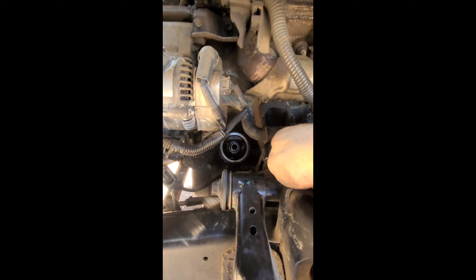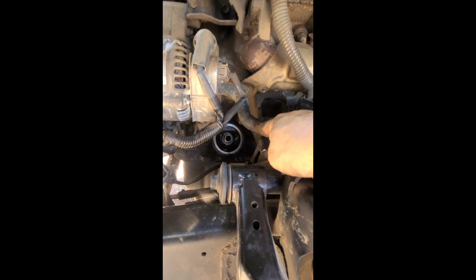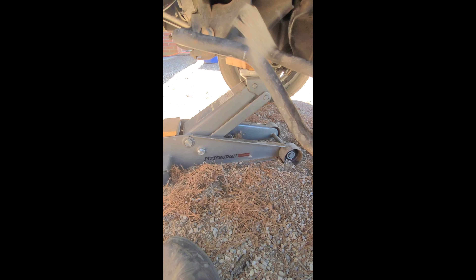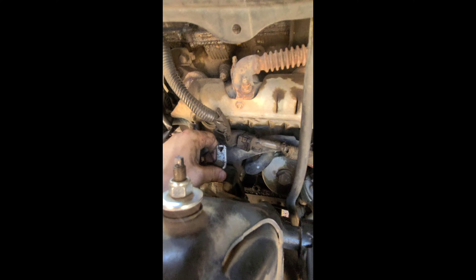Here is the mount — it goes straight to the engine, and this piece here is what we're going to be replacing. We take off one bolt on top, a bolt on the side over here, a bolt over here, and a bolt over here. We're gonna leave those loose but not remove the bolts. We're also going to put a stand underneath the engine with a block of wood so we don't ruin anything and keep it supported so the engine doesn't drop while we're taking this all off.